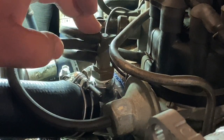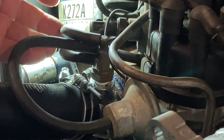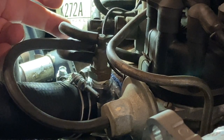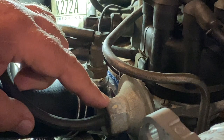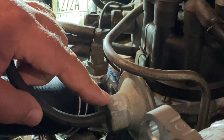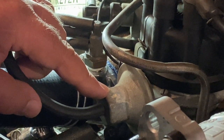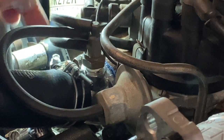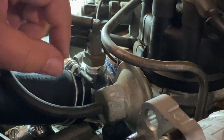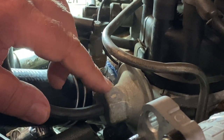The other way these things are used is when the engine is cool or within a normal operating temperature, the ported vacuum will be sent to the distributor so that the ignition timing is altered based upon engine load. But if the engine starts to run too warm, this will cut off the ported vacuum and apply full manifold vacuum to the ignition distributor vacuum advance diaphragm, which helps cool the engine down.